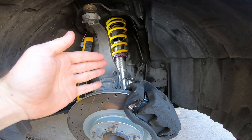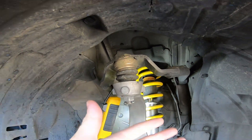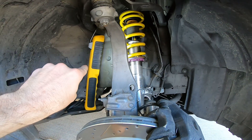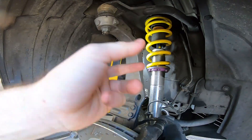The fastest way to remove this is to go inside and turn the wheel to the left. You do not actually need to remove the upper control arm like in every other video. It's much easier to just turn the wheel to the left, which spins this out of the way. That's the secret little trick to removing this very quickly.